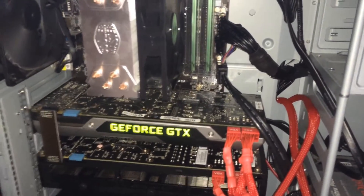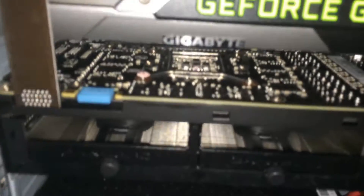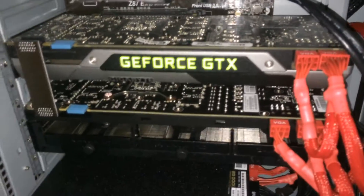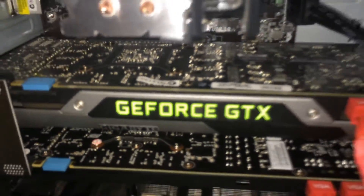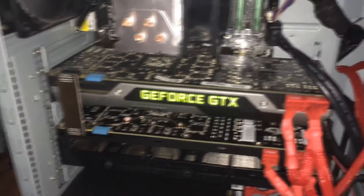You don't want them right next to each other if you're doing quad SLI, but it really depends on the design. If you're running a graphics card with the reference design like the top one, it doesn't matter too much if they're right next to each other, because they push the air out the back of the graphics card. Whereas this one is circulating air with the three fans.